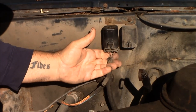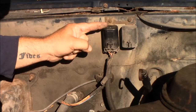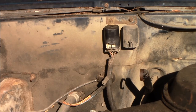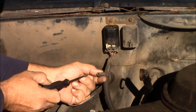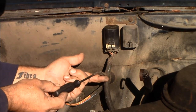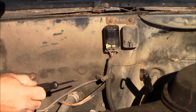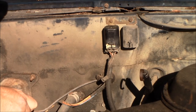In our case it was the relay, so I simply popped the replacement onto the second part of the bracket where no relay was hooked up and threw it in - and that's all she wrote. We were on the road, cranking easy, no problem at all. This original relay I could eventually remove. You can see there's a lead coming off here taped into the harness - this is a factory bypass or test lead. If you take battery positive and apply it to this lead, it runs the fuel pump directly for diagnostic purposes, taking the ECM and everything else out of the mix.